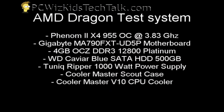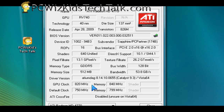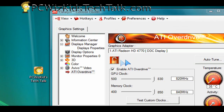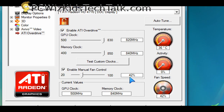This is the system I'm going to test it against — I'll also install a 4870 separately later to benchmark against. I've done the automated overclocking. You can see it's using the RV740 chipset with PCI Express 2.0 support, 128-bit bandwidth instead of 256, and 512 MB of RAM. The default idle temperature is roughly 37 degrees Celsius, and on max full load it's about 61 degrees Celsius. I overclocked using ATI Overdrive's auto-tune, letting it overclock to 820 MHz for the core and 840 MHz for the memory.